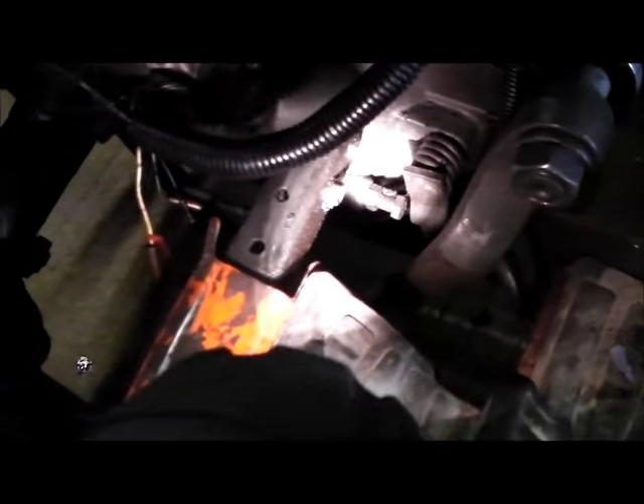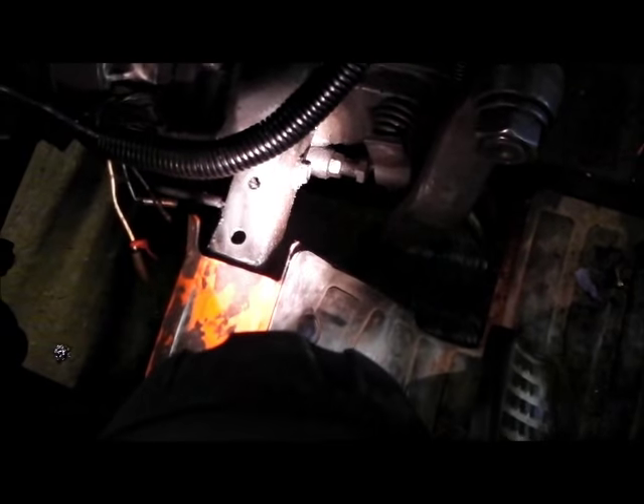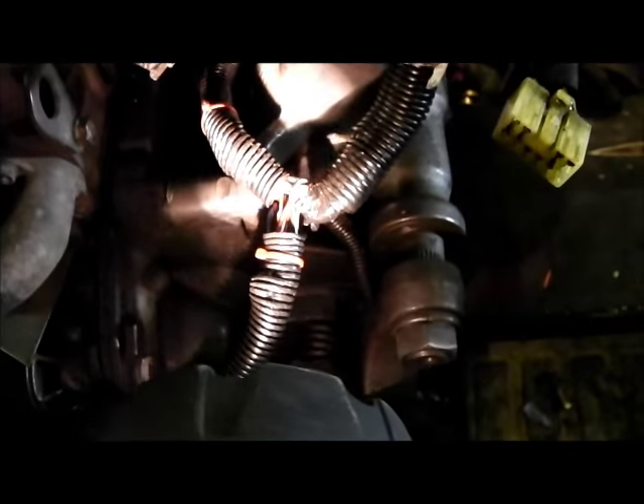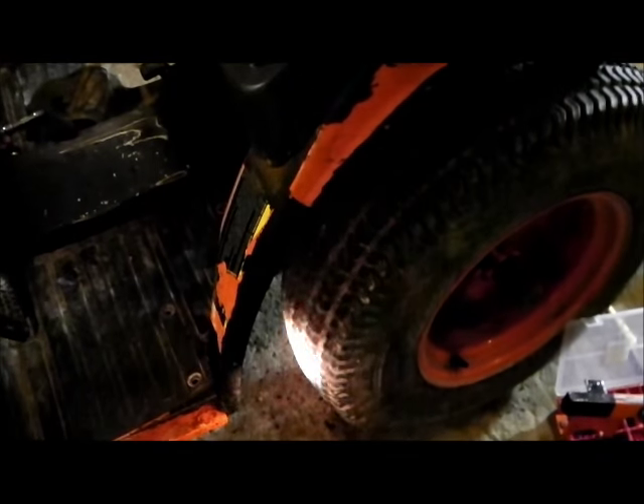You can see where the bulkhead was rocking and started to damage the bodywork quite badly. I've managed to tighten up the mount on that side — I thought the thread was stripped but actually it was just loose. Where the bulkhead's been rocking you can see it's come close to crushing the wiring loom and it's been starting to damage it. I haven't found any breaks yet but everything has fused out, so I've got some tracing to do there. This side I've done, so you can see where the black paint is — there's been repairs. There was a split there like the other side, so I welded that up.